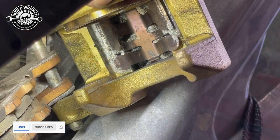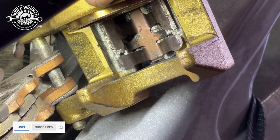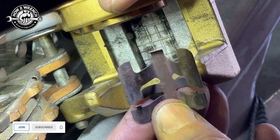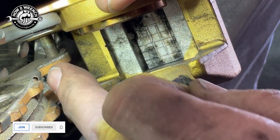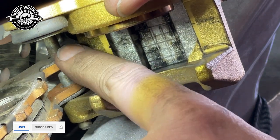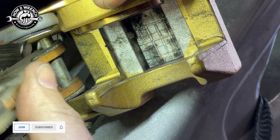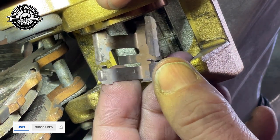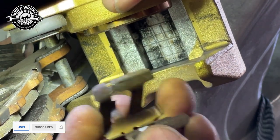I want us to focus on these two little tabs right here. Let me go ahead and pull that out. This spring retainer — sometimes you'll hear people reference it as an anti-rattle spring — applies just a little bit of tension on the pads so they don't wear out that pin as they slide back and forth. On dirt bikes you always get divots; it's real common to replace these pins on off-road vehicles. What this does is just put that little bit of tension pressing on the top of the brake pads.